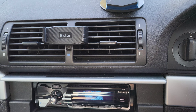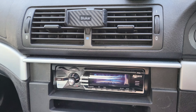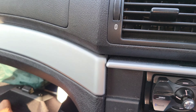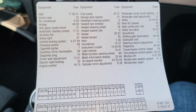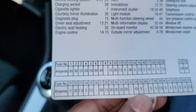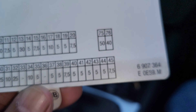I took it away and thought I'd just take the fuses out and put them back and see if that makes a difference. The weird thing is - it does, it actually worked! The fuses I removed were the air conditioner ones, numbers 9 and 20, and then fuse numbers 75 and 76.